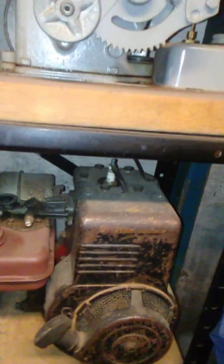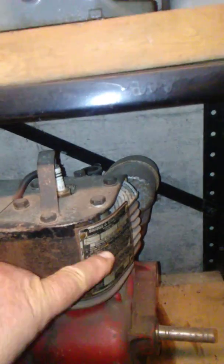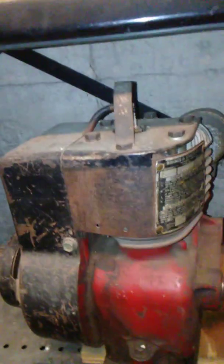I've got a suction carburetor on it because that's what I had. It didn't come with that, but even though it's a cast iron block like a 7S, it does still have the piece of tin over the top of the head. Now the nomenclature and the piece of tin that it's on aren't actually to this motor. Neither is the oil pan. Sometime or another somebody's built this motor from pieces.